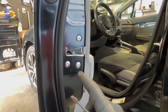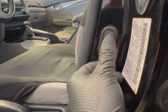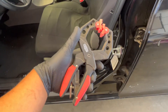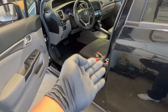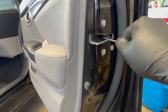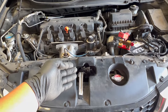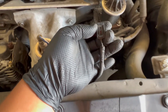First we're going to close this door latch to make the car think the door is closed. There's a switch that gets pushed in when the door is closed, and we've got to keep it closed. I'm going to use one of these clamps to hold it — I'll put a link in the description. We're going to do the same thing on the passenger side. Then we've got to make the car think the hood is closed, so I'm going to do a bypass on the hood latch switch and install a jumper wire.